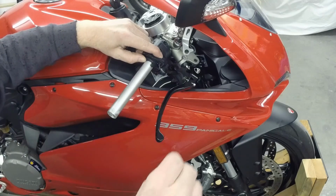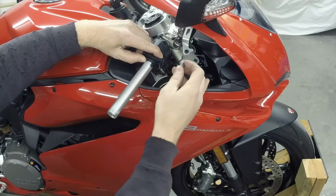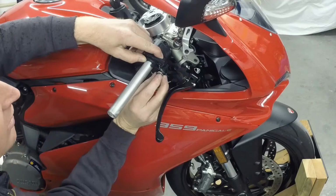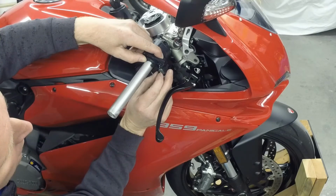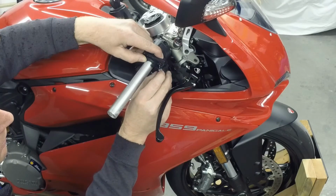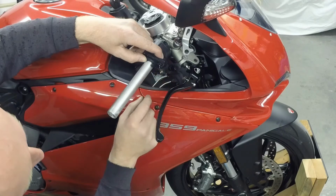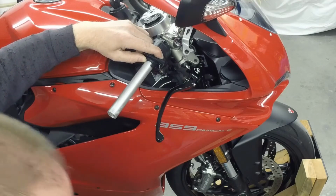Then you're taking your gear. This is what controls the throttle position sensor. This is a magnet that controls the sensor, which is on this side. And you have to line up that spring there into that little hole. It's hard to see, but it's there. And then you have to clock this thing correctly. I'm going to put it about the way that it was when I first started this. And then we're going to test it by starting the bike, and hopefully I did it right the first time. So it should be right there. Hopefully that's right. If it's not, we've got to start all over.